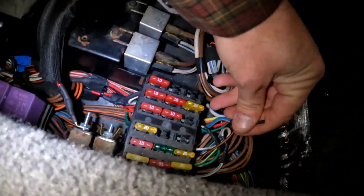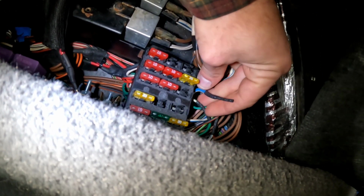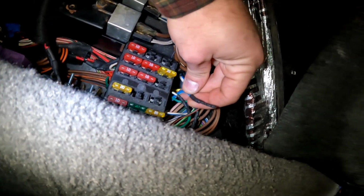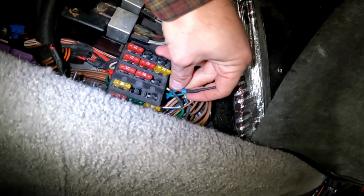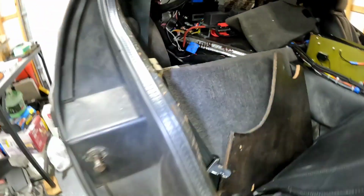And I actually have the bright wire pulled out and with a piece of heat shrink on it, so that's super easy. I got to order some spades and solder a new one on the end of that, stick it in the fuse block, put the fuse in there, and bright's fixed. So fixed one problem and found a couple more.